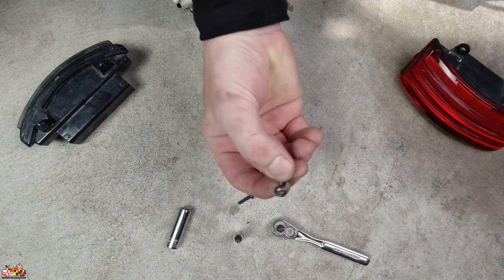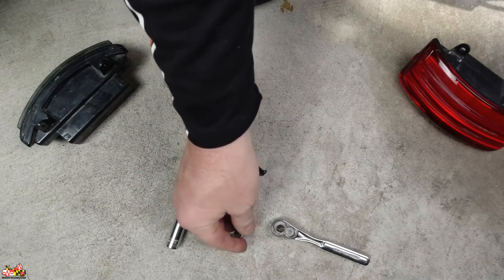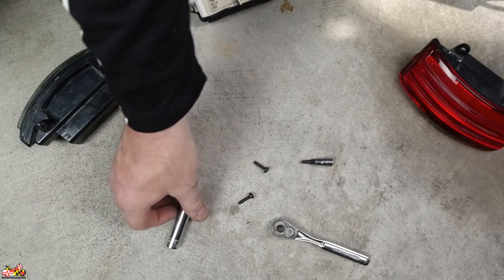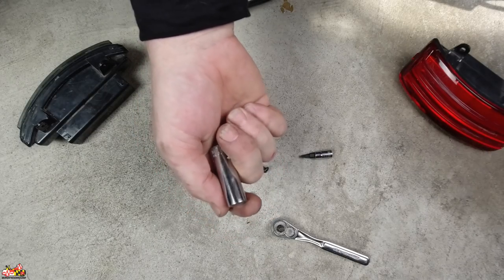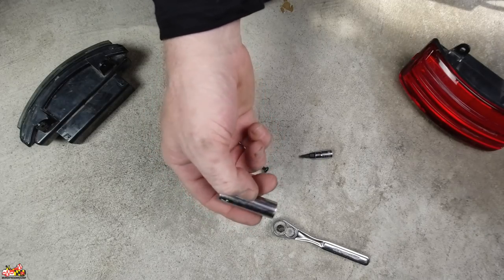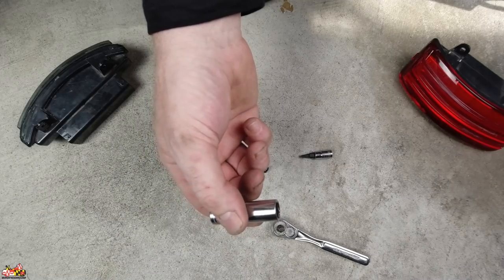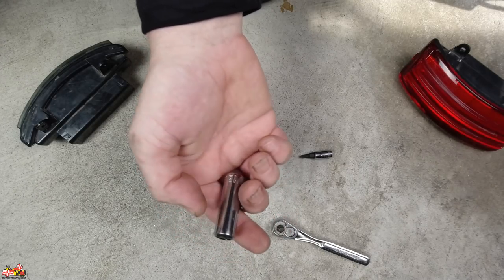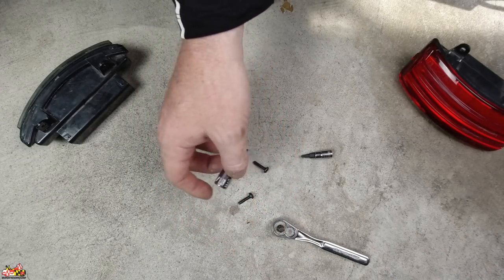This is what the bolt's going to look like and the size of it, actually behind the bike. Here's the T25 Torx bit that you're going to use. Now the reason I mention a deep socket for the 7/16 nut — when you get underneath, you could use a regular size socket, but having that deep one makes it a little bit easier, you have a little more leverage, and it's very tight with a regular one, so I'd definitely recommend using the deep socket.